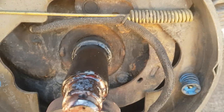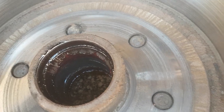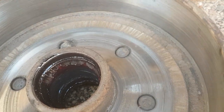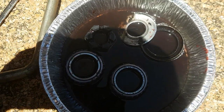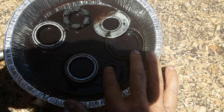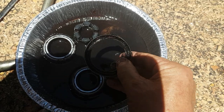Brake cleaner done. Now just get a rag and clean all the old grease off the axle and out of the hub. You can see the old grease has gone dark with age — this camper has done 10,000 kilometers since I last did the bearings. For the bearings themselves, use degreaser or a bit of unleaded petrol to clean the old grease out and get them nice and shiny. If using unleaded, keep the rear seal out of it because the rubber seal doesn't like petrol — don't leave it too long in the degreaser either, it'll make the rubber go hard.